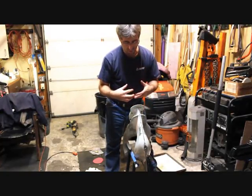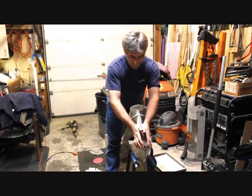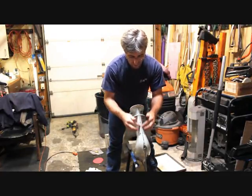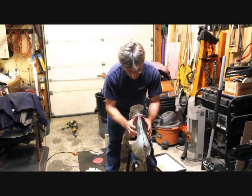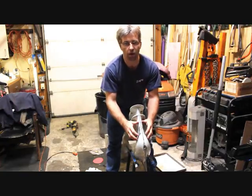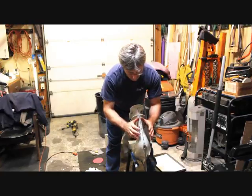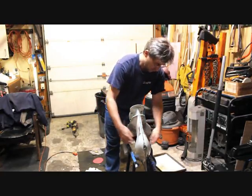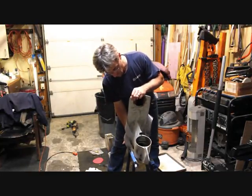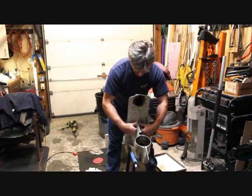We thought, if we're going to block it off, we might as well block it all off. So we just tape this up, put some expansion foam in there, and we've already put our line down the middle as our center line. Then we're going to take our 32-grit disc grinder and basically feather this guy out a little bit - nice and smooth - and do the back side also, tapering it off like the trailing edge of a wing.